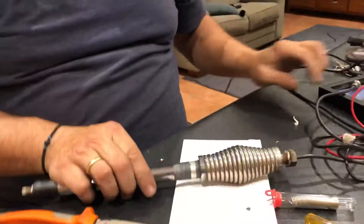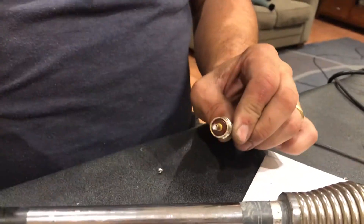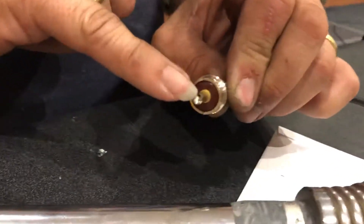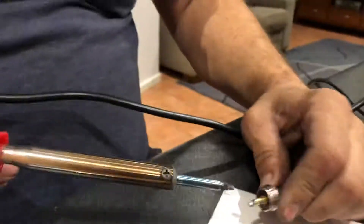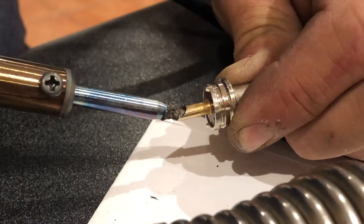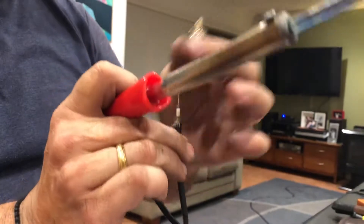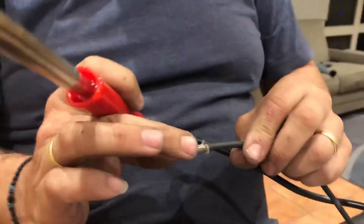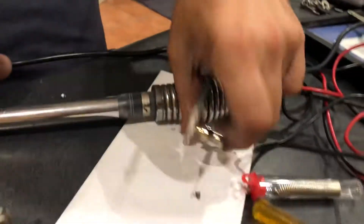To get this through your firewall - this is quite a big plug. You may or may not know, but that is actually soldered there, so you've got to unsolder it. Once you've unsoldered it you can untwist it and it comes out, so you can pass it through the firewall - maybe through one of the rubber grommets where the loom comes through. Just want to make sure that this is clear.